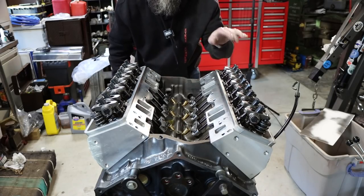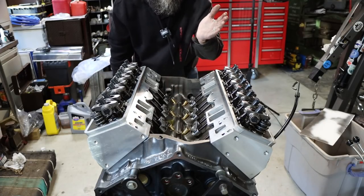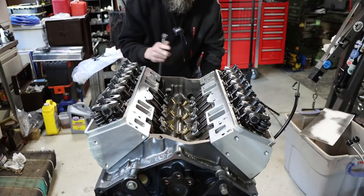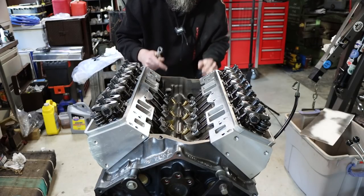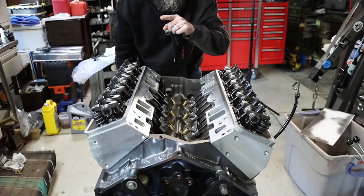And I don't have to worry about keeping up with firing order or watching the valve train to see which piston's up on number one. Just 2 rotations, stopping every 90 degrees, and taking the slop out of the loose ones. And you're done.